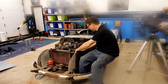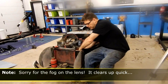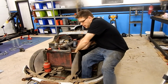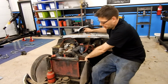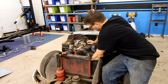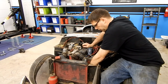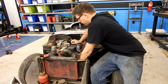Alright, what we're doing now, trying to get the steering shaft off, so there should be a bolt where the shaft goes into the steering rack, and that's going to hold it on. That can sort of pinch it down, so I think I'm removing that now. And then we should be able to loosen the column from the column support in the interior, and the entire thing should pull out and pull through. Tight fit, because again, we're trying to minimize any mechanical stuff being taken apart.